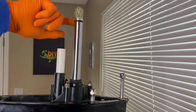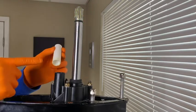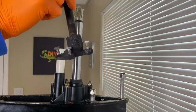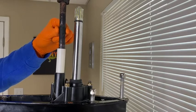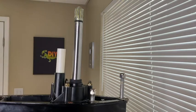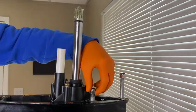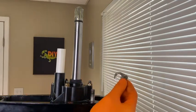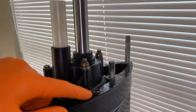Also lubricate the O-ring that we greased in the previous steps during the water pump install. Next, direct your attention to the water tube — we also greased the base of this tube in the previous step; there is a seal in there. Here is the old water pocket cover, overheated and melted. When we shift the lower unit in place to the upper unit, it will guide the water tube through the brand new tube, and the base will go into that seal, so make sure that seal is lubricated. The brand new water pocket cover is already installed on the upper unit. Next, we have three 5/8 nuts — carefully remove these without dropping them inside the engine, as well as the washer and small Phillips screw.